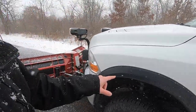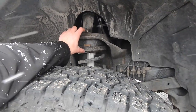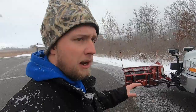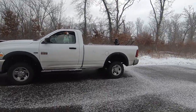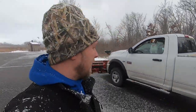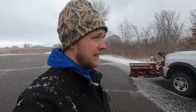We did lift this truck up — or level it — with a 2.5-inch Rough Country leveling kit and added the new Rough Country springs. The thing rides really nice; it's actually quite surprising how well it works. Been overall thrilled with it, and it keeps that truck looking real nice and level even with the snow plow on it. If we didn't have that in there it would be really low in the front and we'd be struggling to get over curbs, but this lifts over curbs quite nicely.